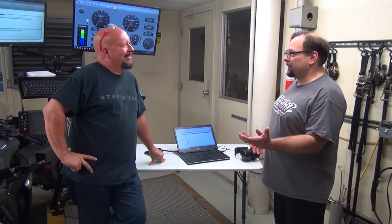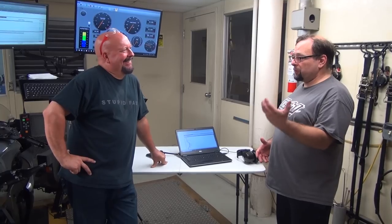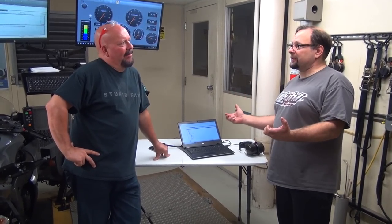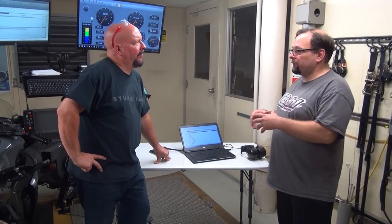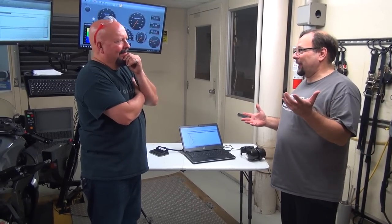And so now you have these throttle maps that are used to close the throttles down if detonation is detected, to help save the bike. It also retards timing and things like that. These are all the safety factors that are built into the H2 ECU. And I see these throttle maps modified and wide open, and so now it's detonating. You're on a land speed run or something, and it's detonating where it would normally start reducing power to save the engine. It doesn't do that anymore. And I don't know why somebody would edit those maps the way that they do, unless they don't understand what those maps are doing.